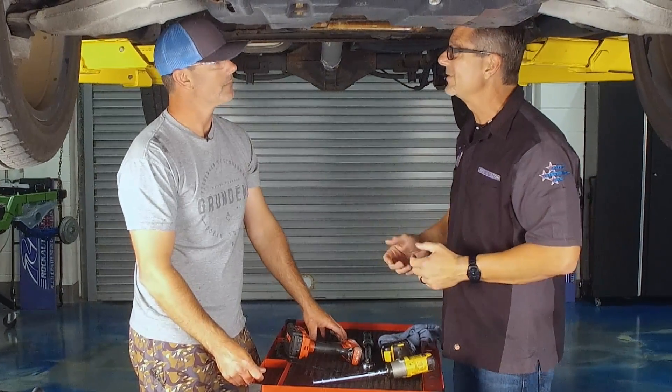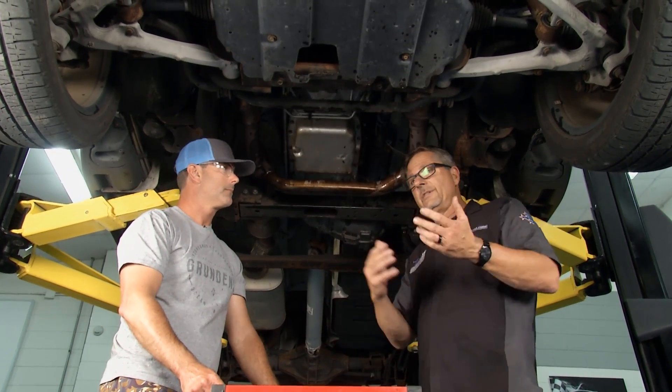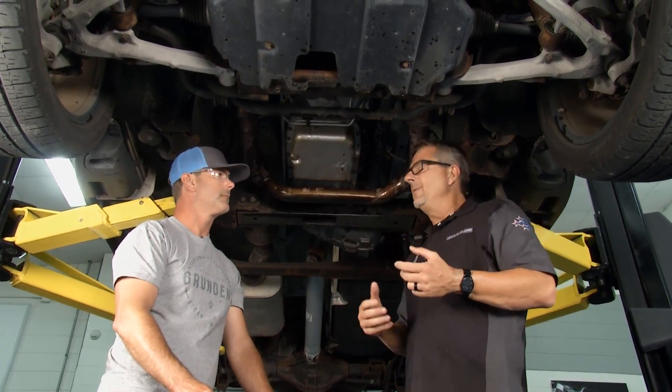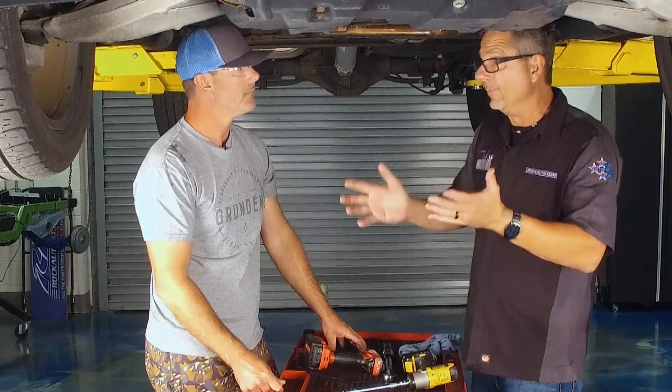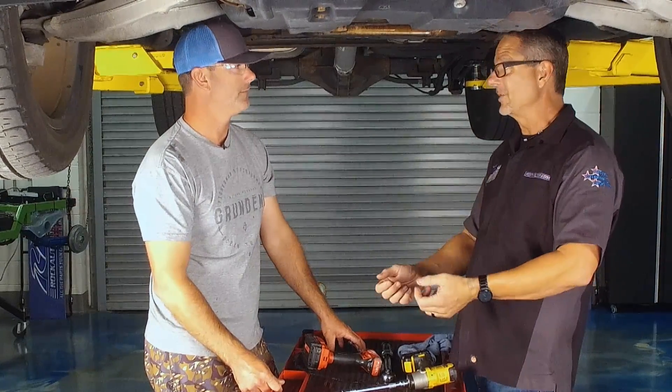Computers are pretty smart now and it squeezes it tight. That brings us to another point — some old transmissions, you used to feel it slip in and slip in. Well, that's not the case today. A transmission today may squeeze it real tight and wear the clutches out, squeeze it even tighter, wear them out more, and then eventually just go, 'I'm not running anymore,' and you're sitting there stranded. So it can get pretty rough.